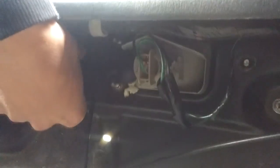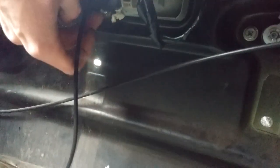So it's just held on by all these little bolts here. They're all just like along here, little pegs like this. They literally just take one little twist from a ratchet and you can undo them all by hand. So it's very easy actually to do taillights. It's the same for the center panel garnish thing down there. And they use the same bolts for both the Kouki taillights and the stock ones, like the Zenki ones. They're both stock, but you know what I mean. But yeah, it's fairly straightforward and pretty simple.